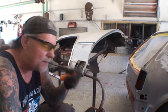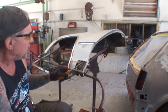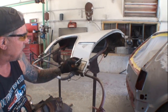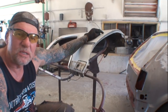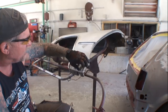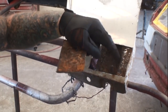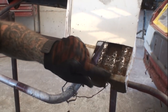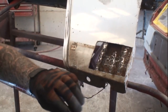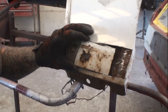That's gonna let us keep our situation here where we have a rust problem. Now the reason that this fender rusted out is because up here on the top of the fender, water will run down, and if you look at this fender brace in here, you'll see that the water would run down inside it and then gather up right here. We're actually really lucky that it didn't ruin this lip section right here and also over here on this edge.